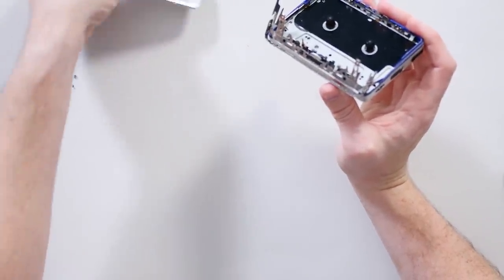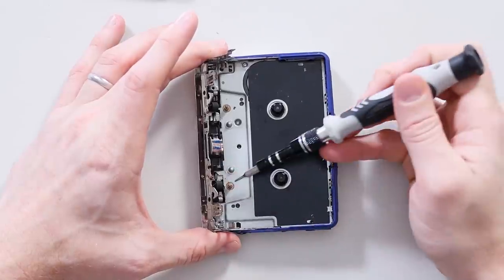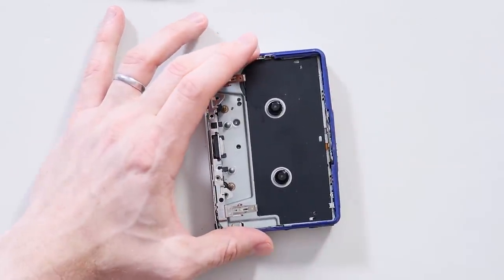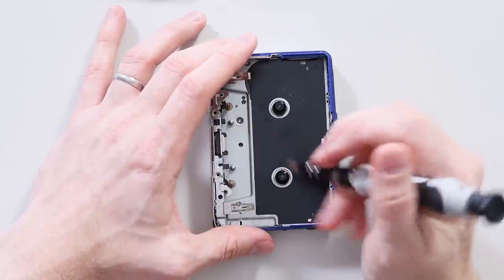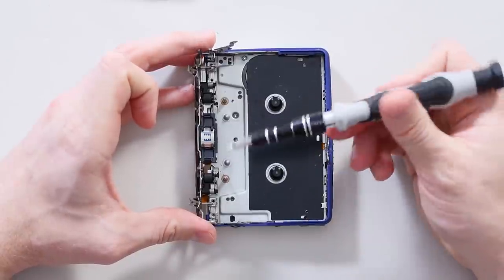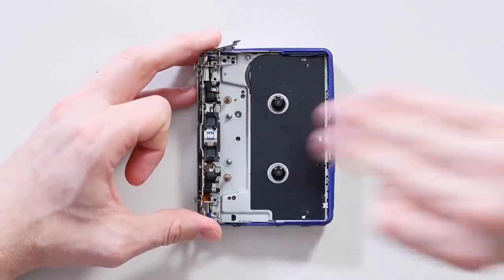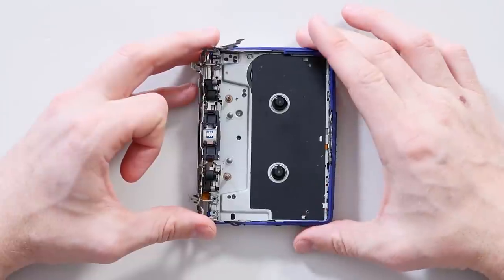There's the very small weight of the outside cover of the tape drawer, and that instantly reveals all the tape transport mechanisms. I think that would technically be the capstan, and those would be the pinch rollers — spring loaded, pressing the cassette onto those rollers when it's playing. That provides transport at the fixed speed needed for tape playback. The spools will change size depending on where on the tape you are, so you don't use those for transport — just for spool and release. And you can see on the read head — it's actually a four-track head because of the auto-reverse feature. This doesn't need you to flip the tape; it reads left and right channels for both sides in one physical position.